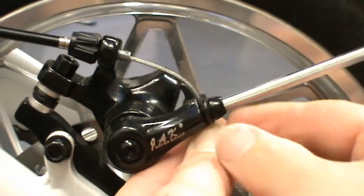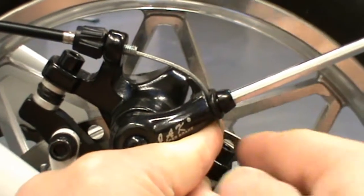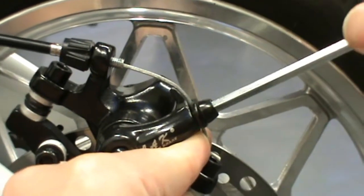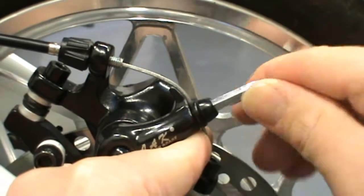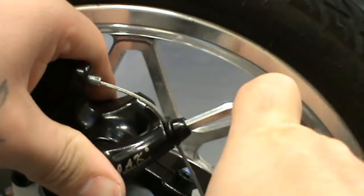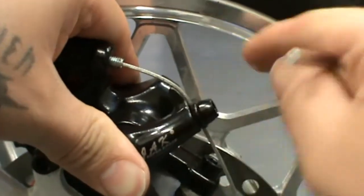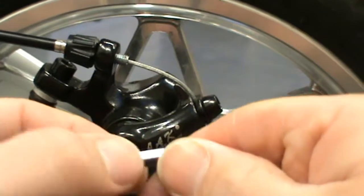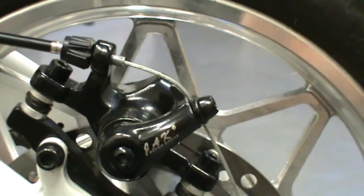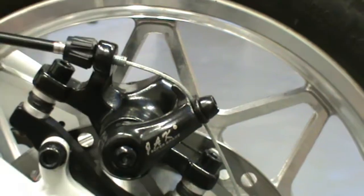If you open that just a half turn, the arm is free. All you're going to do is maybe use your finger just to push the arm just a little bit and hold it — I only moved it 1mm, very subtle. Just a millimeter to make it a bit tighter. Then hold the caliper and give that a good turn. You don't have to go crazy — you will strip the threads in this arm if you go too much. You could damage your allen key or round off your bolt. Make sure you've got good, sharp tools.